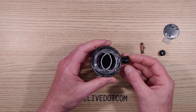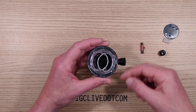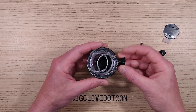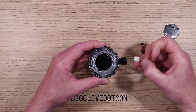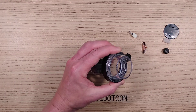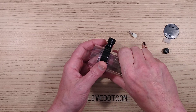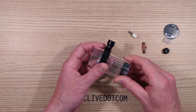When they want to release that, they presumably put it into an almost solenoid-like magnet — a cylindrical magnet with a core that basically pulls this slug back, and as soon as it's pulled back, it releases it. That's why you hear them bang it trying to get it to open. In reality, if they put a very slight bit of twist pressure as they put it into the magnet, it would just theoretically pop open easily.